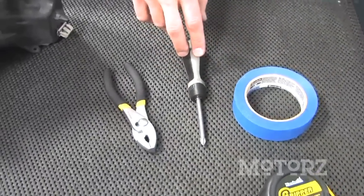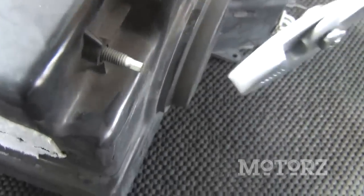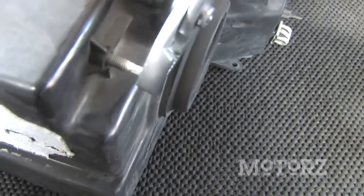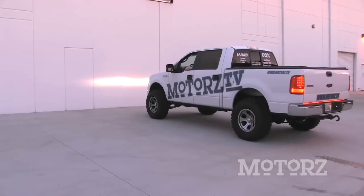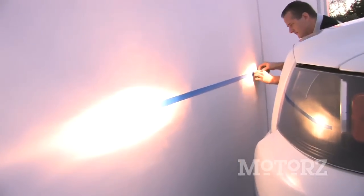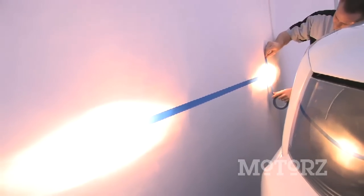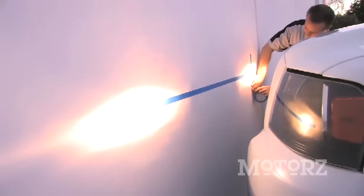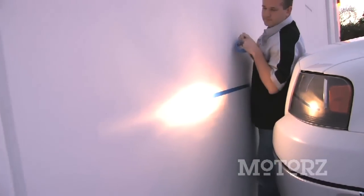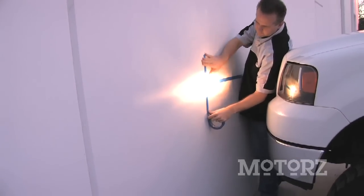A screwdriver will do the job for many vehicles, but for our F-150 we just have a single post for alignment - we're just going to use a pair of pliers to twist that. Find a vertical white wall and a level surface; you can use your garage door if your driveway is level. Place your vehicle as close as possible to the wall - about six inches will do. Then turn on your low beams and mark the horizontal and vertical center lines with your masking tape. It may help to have a buddy stand behind the vehicle looking through the back window to assist in tape placement.